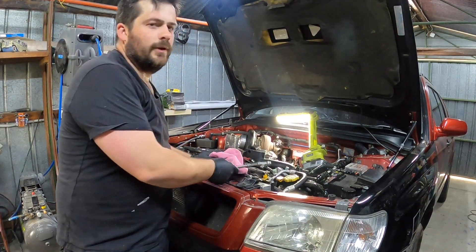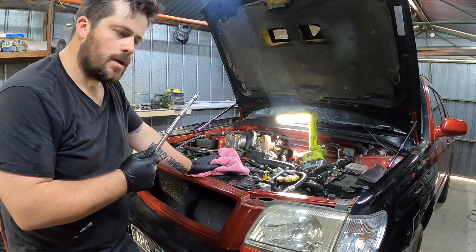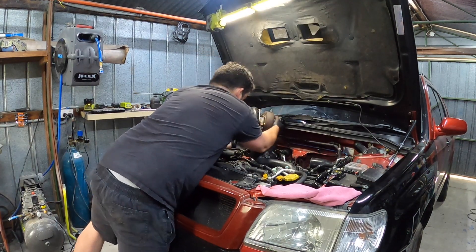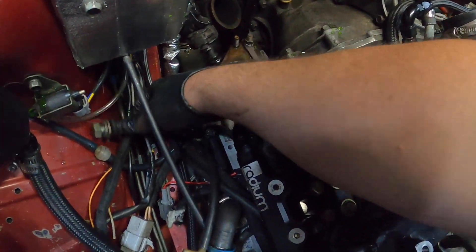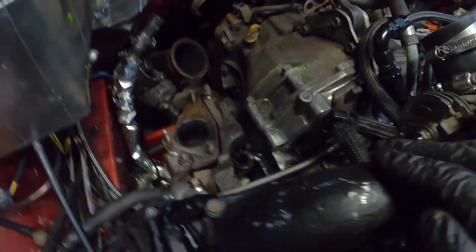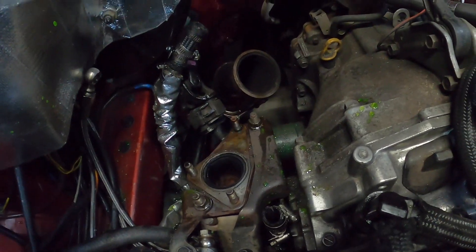Here's one for you - that hose clamp on the drain wasn't tight. The compound system is off. It was just dripping down into the up pipe. You might be able to see now that there was a kink in that. It's pretty dark - it's about halfway down. So we're going to sort that out.